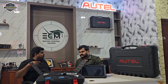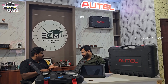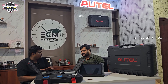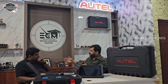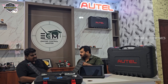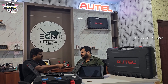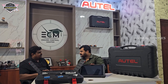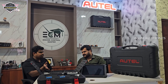This coil signal probe is also very helpful. We have heard so many times about coil plugs going wrong — you don't know whether it is a coil plug, a spark plug, or a wiring issue. With the Ultra, it is going to help you solve those kinds of issues, especially for coil plugs. You can save more time — it is always about time saving. For a premium or supercar, the car has to be at his house, not in our garage. You can quickly rule out the problems: put this directly on the plug coil, see the signals, and immediately understand whether you need to change the plug or the coil itself.